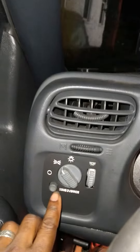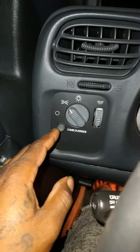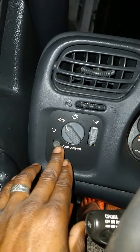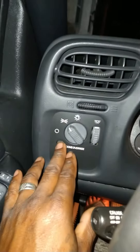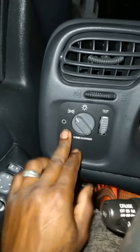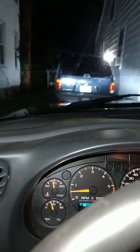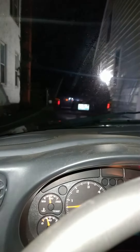What I found out today was this little switch on the dash — this dome override switch. I never really knew what it meant. When it says 'override,' it's to cut your dome light on and off when your door is open or your hatchback glass is open. But if you hit it in sequence, your daytime running lights come on, and if you go like this, you cut them off. So you hit it a couple times in sequence to turn your DRL on or off.